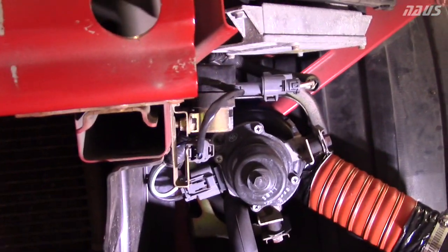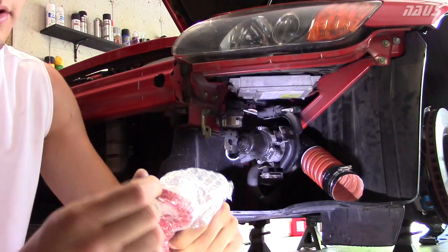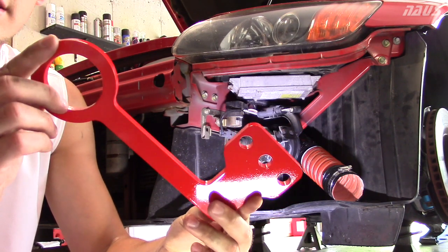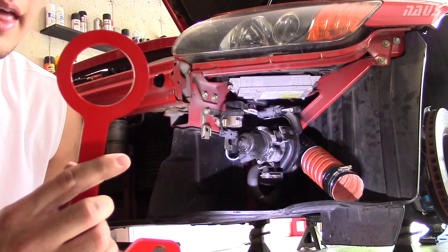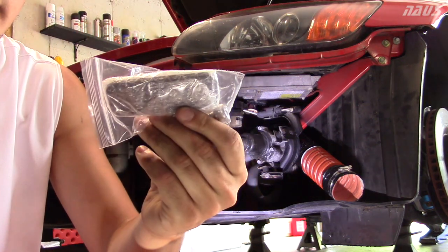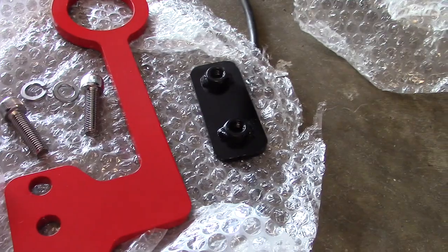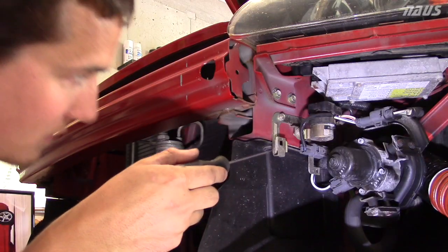It's not going to stick out from the front bumper too far - it should look pretty clean and not super ricey. Here's the tow hook - it's just a laser cut piece of steel, powder coated red, so it'll match my car pretty good being an NFR AP1. It looks to be about a quarter inch, probably low carbon steel, just powder coated. If you were to actually get towed out and someone put a metal hook on this, it would obviously scratch the powder coating off and then potentially rust. You also get your bag of hardware - two socket head cap screws, which I believe are stainless, a backing plate with two tack-welded nuts painted black, and two locking washers.